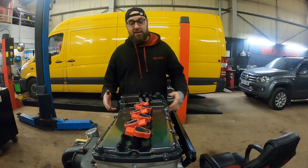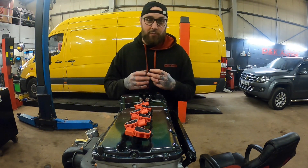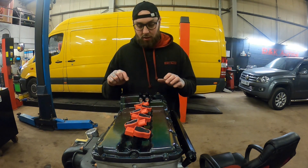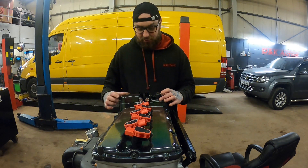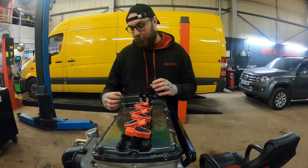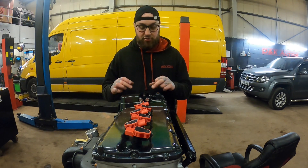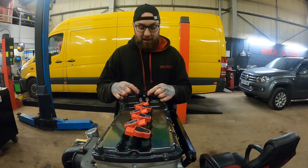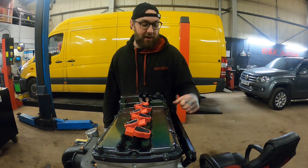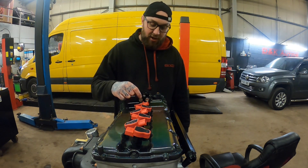Now you've seen what the cam cover looks like — how shiny and reflective it is. Going into what I've done with the breather setup: I messed up a little bit initially. In this tower bit that stands up there's a plastic piece with a diaphragm, and you have your normal OEM breather fitting that goes to the intake manifold — that's all gone. I'm doing a catch can setup venting to atmosphere, so I just had two fittings. At first I just had straight AN10 fittings straight out the top — those are the ones now on the fuel rail.